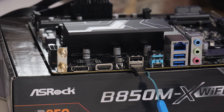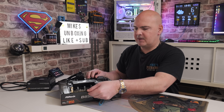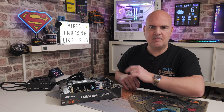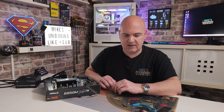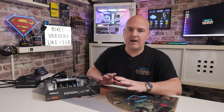The BIOS LED has gone out and the power supply has clicked off — that means the flash has completed successfully. We're happy that the BIOS has been flashed. You can now turn off the power supply and remove the USB stick from the motherboard. If you've already got your system fully built in a case, you can now boot it back up and see if it recognizes your CPU. The most common issues preventing a successful flash are unrecognized USB drives, wrong drive size, or incorrect file naming.